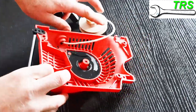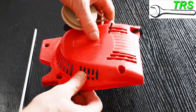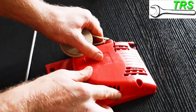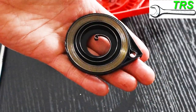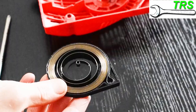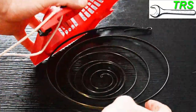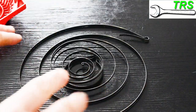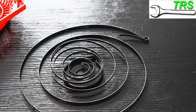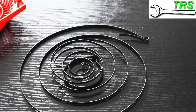We then need to have a look at the recoil spring itself, so we need to remove that. The best way is to turn the recoil housing upside down and knock it on the table. There we should have the recoil spring, and hopefully it's still neatly packed into its housing rather than exploding out. But if that does happen, I do have a video on how to replace it — it's in the link below in the description — providing that the recoil spring is in good order and reusable.